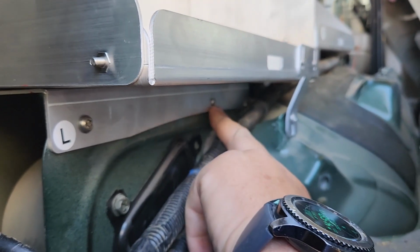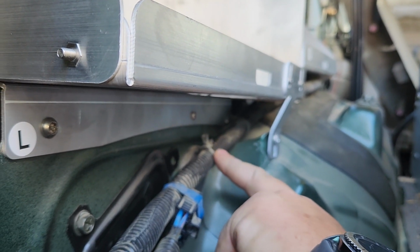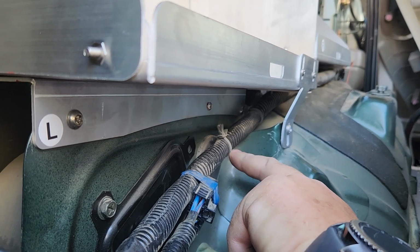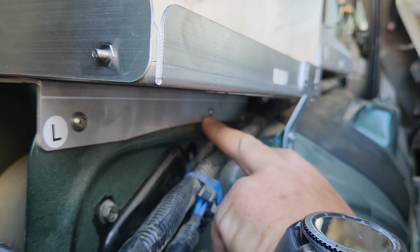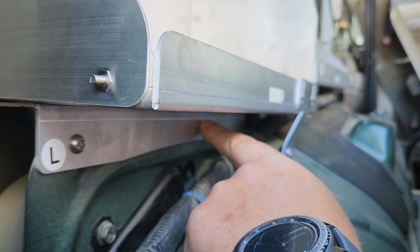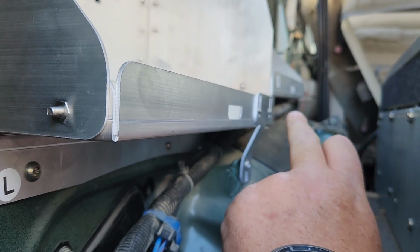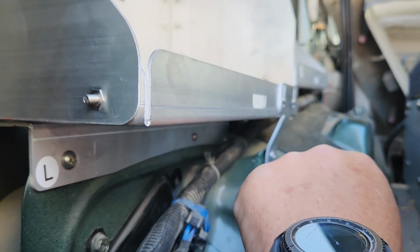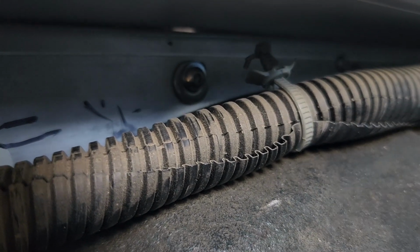These other holes, these 2 holes for these 2 nutserts, that one and that one, line up with these clips for that cable. Now the other ones didn't, so you've got to put this side on first, sit it all on, bolt that back down to there and up the top just to center it, and then try and mark those holes for the other bracket on that side. You can see under there, there's a hole there, and there's 3 altogether. You can see there I was trying to mark it. There's my texter.